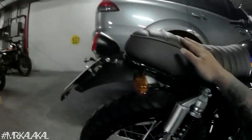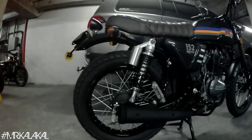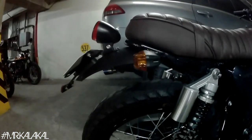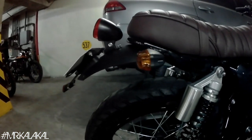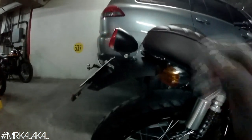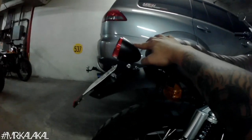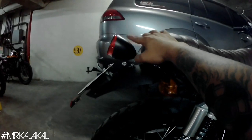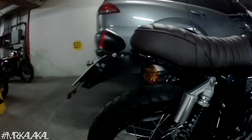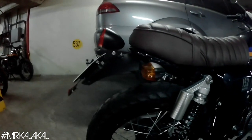If you look at the side profile of the bike with the stock fender mounting, it droops too far down — it looks bad, almost like it's bowing. So we modified and raised it a bit. You might wonder about the taillight — it's still visible, and actually more visible now. Especially to SUVs, trucks, and buses. The stock angle pointed the taillight too far down, making it less visible in traffic.